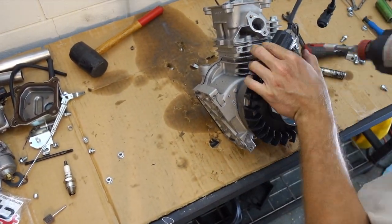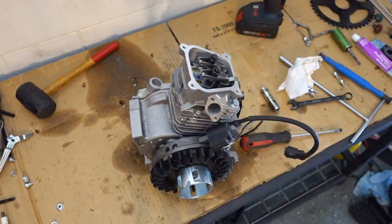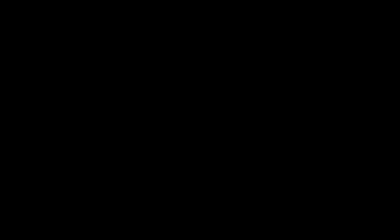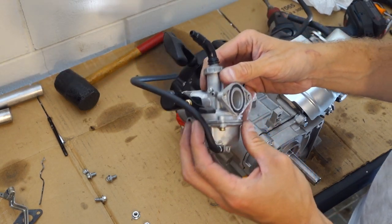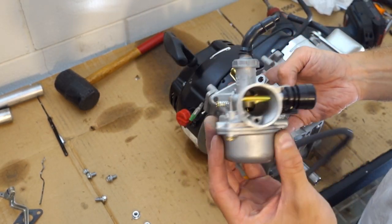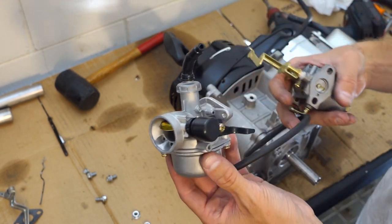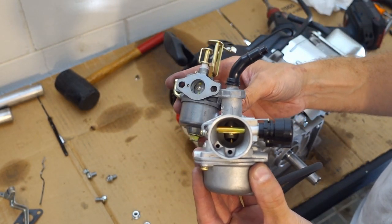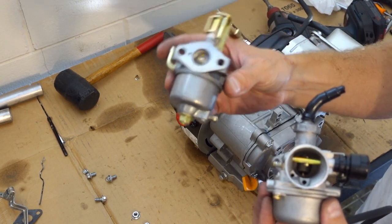The last and final performance mod covers both intake and exhaust. For intake, we're talking about either increasing the jetting of your stock carburetor, or in my case I went with a 19 millimeter aftermarket slide carb to allow more airflow and more fuel mixture. These are not very expensive — I recommend upgrading to the 19mm carb. However, if you don't want to spend the money on the upgraded carburetor, you can use the original, but keep in mind that because of the modifications already made to the engine, you're probably going to want to go up a couple of sizes in jetting to get the appropriate amount of fuel.